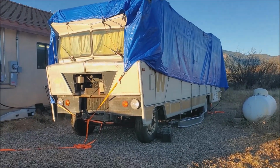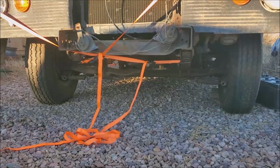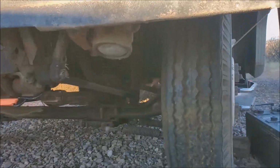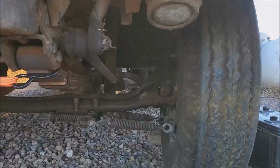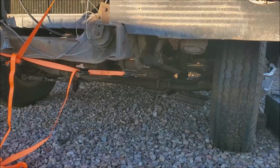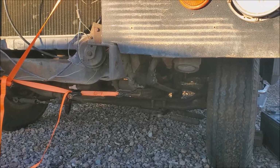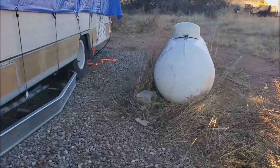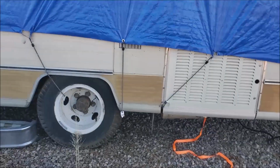That's my thought. Problem is, we come under the front end. We're looking at this. It is an old school two-wheel drive straight axle. And the drag link, the steering linkage on this, you can see the steering box mounted there. It has an old school style push-pull drag link that's hooked up over here. Now, where do you find a straight axle anymore from anything made in the last 20 or 30 years that's even remotely this width? And the answer is you don't. The rear end is a Dana 70 HD. It's got 456 gears, but again, we got this odd five lug bolt pattern.